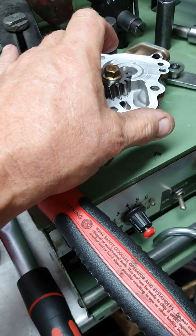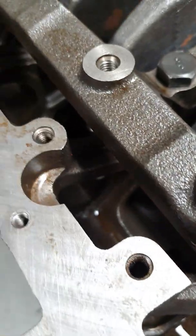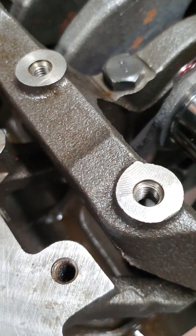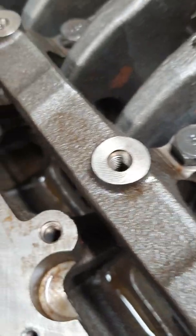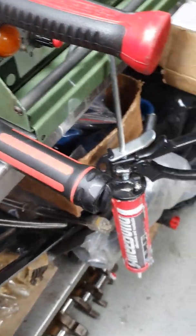On the passenger side shaft, it just feeds with splash — there's no oil feed actually going to that bearing hole — so I just leave that bearing shell out of there and it's just an empty void with no shaft in it.